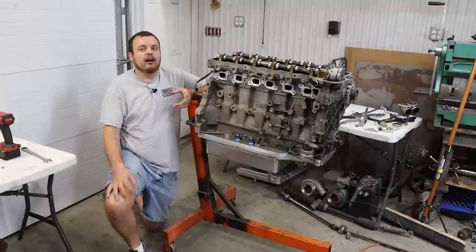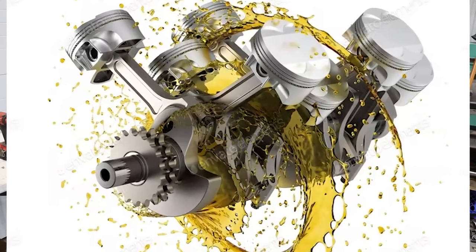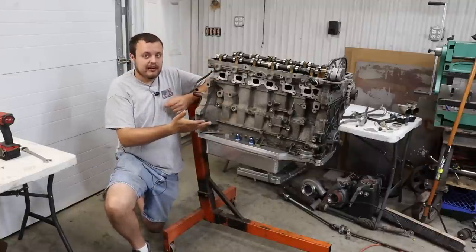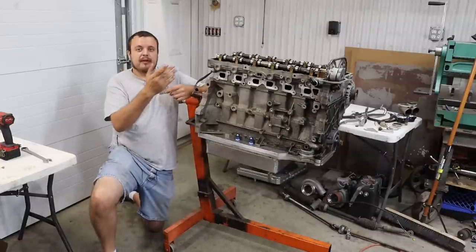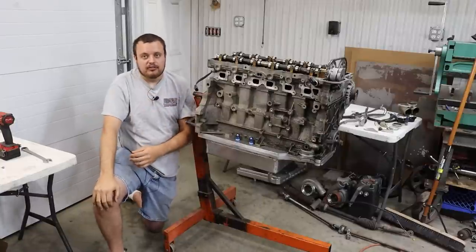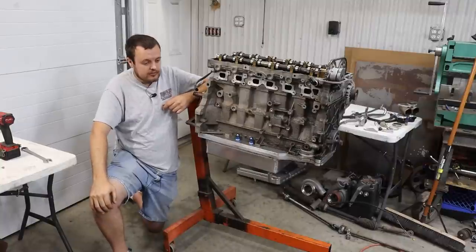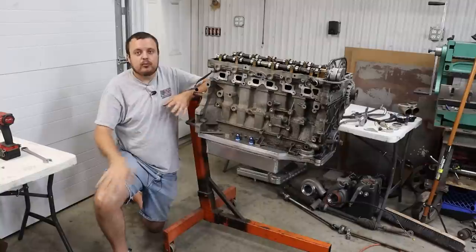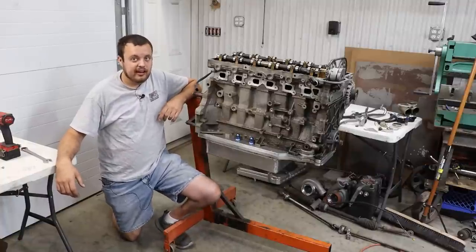So let's go back to how the oiling system works. After your bearings are lubricated, the oil is shed off of your crankshaft and shed off of your camshaft, and it has to drain back to the oil pan somehow. Now, oil has weight, and that means that as it drains past your crankshaft, it can cause additional parasitic losses. If you can imagine little droplets of oil draining down, as your crankshaft is rotating, it can hit these little droplets of oil, and that causes resistance, which causes less torque to make its way out the back of the engine. Therefore, if we can deal with those little droplets of oil as efficiently as possible and get them down and out of the way of the crankshaft, we're going to be much better off and it will result in more horsepower production.